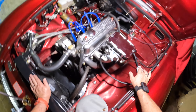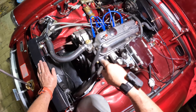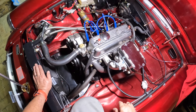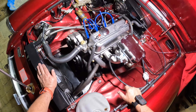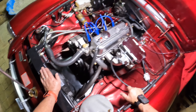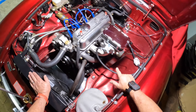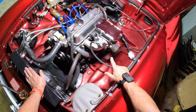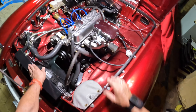I'm going to take the rocker cover off and readjust and tighten down on the head to make sure. I think it's done about 800 kilometres, so I'm going to re-tension the head. The engine starts, but I know the centre manifold flange leaked, so anyway, that's fixed now.